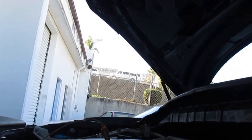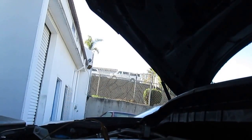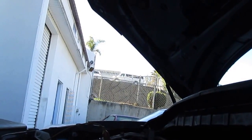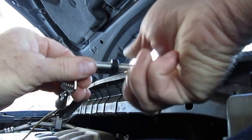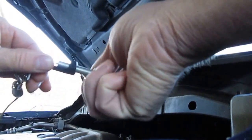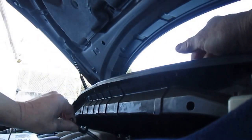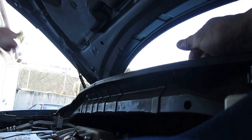Now I'm going to shut the engine off and install a new coil. Then we're going to set our scale back up to 30 kV, which any good coil should put out — no problem at all. So there's our 30 kV setting, and now we'll start our engine.